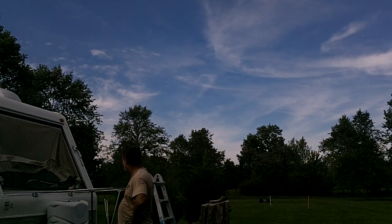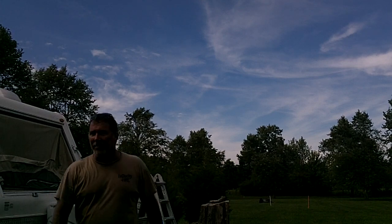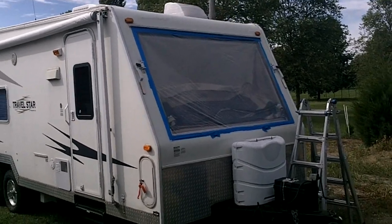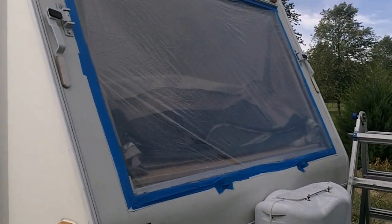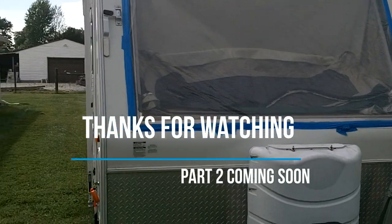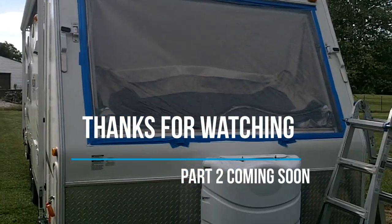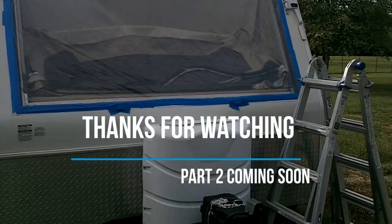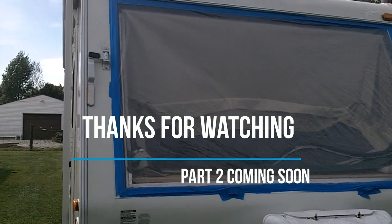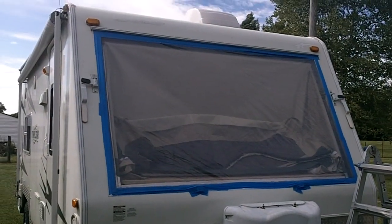This isn't going to happen in a day, so now I've got to close this up and make it watertight so if it rains it doesn't ruin what I've already worked on. Here's the day one end result — I took the bunk off at the piano hinge to take it inside and work on it. To keep this opening protected from bugs, rain, and moisture, I put plastic over it with painter's tape sticking to Eternabond tape that I ran all the way around the perimeter. I'll keep an eye on it and fix it if needed. No storms in the forecast that I know of, but that could change. See you next time.